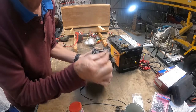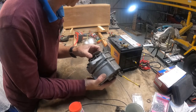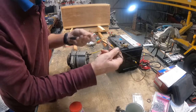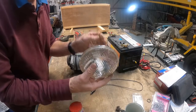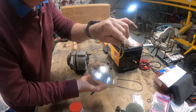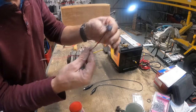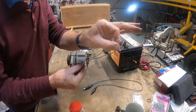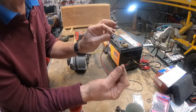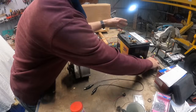There's your output to charge your battery, and this is the wire I want to talk about. For bench testing alternators, you'll need a wire or two to connect things up. I'm using my favorite test tool — a car headlight with two alligator clips. The other bit you'll need is a small light globe, like an instrument light from a car dashboard, with two wires soldered to it. This is the critical bit for testing an alternator.